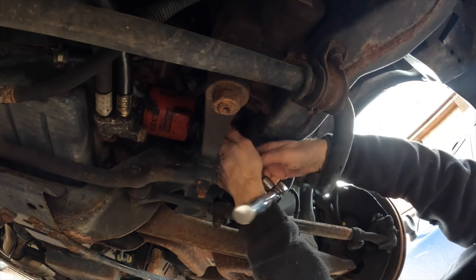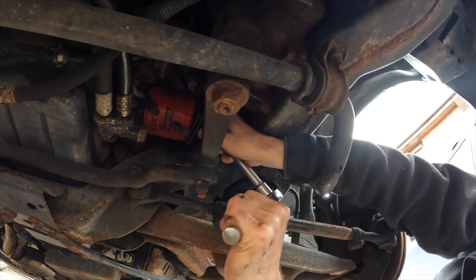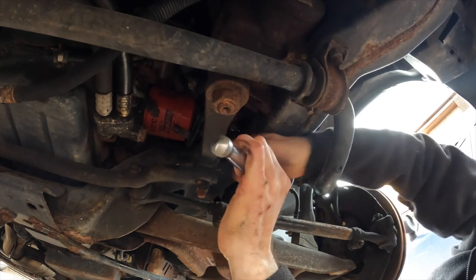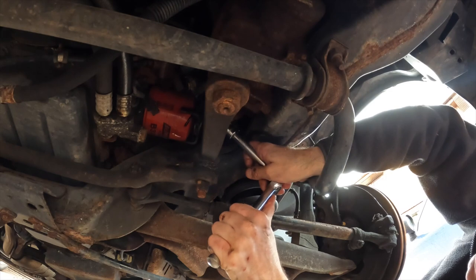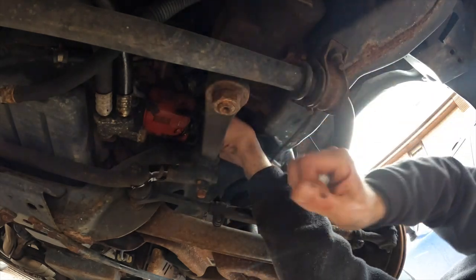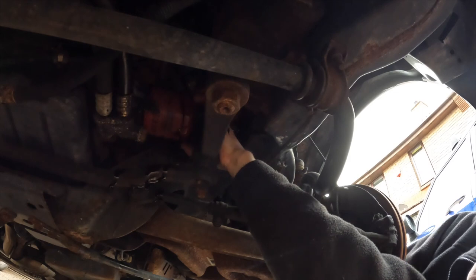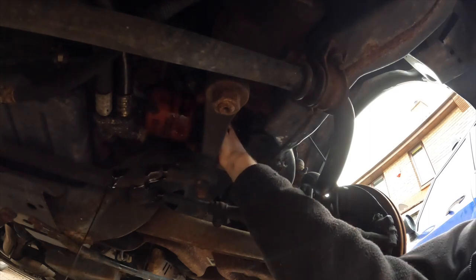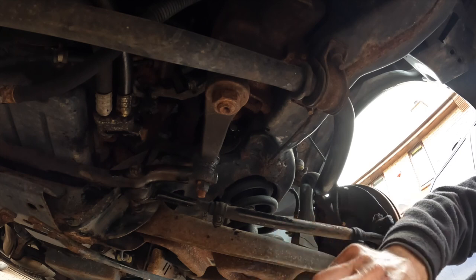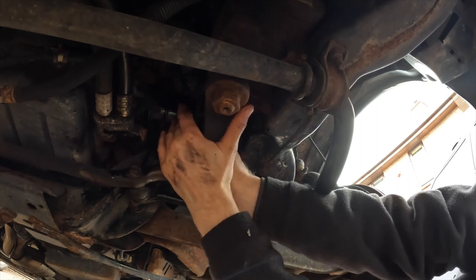Now I can undo the filter without any destruction. I'm just a tiny bit concerned — having found the filter that JR's did a bit of research on — I knew it was shared with a Mondeo and I double-checked it was a two-and-a-half litre Mondeo, interestingly. I might have the wrong one so I'd have to reuse this before I can move the car. There we go — I might have pierced it so it's not being reused whatever happens. I must get some more gloves, I'm out of gloves. New filter, dribble of oil on the rubber, and on it goes — excellent, and it fits. That's always a massive relief.